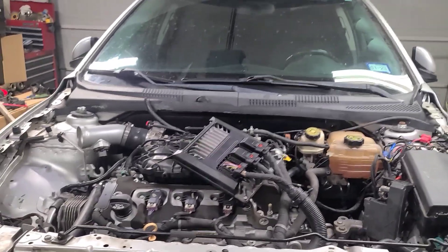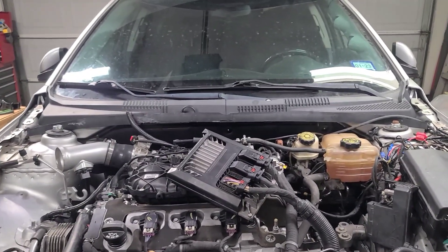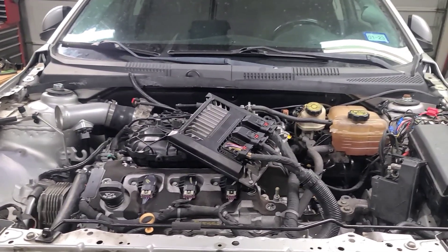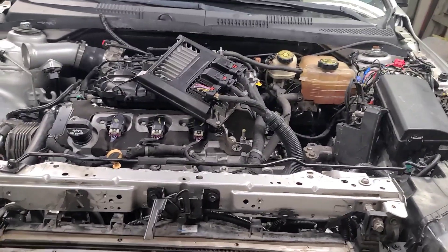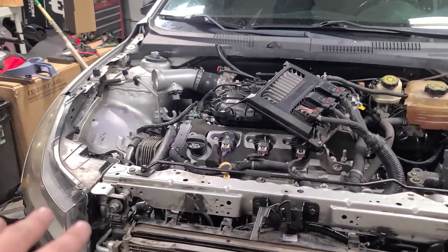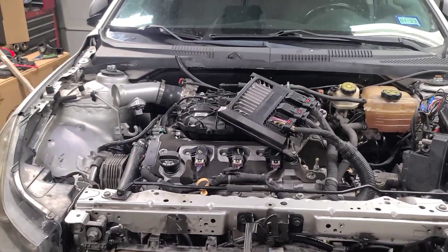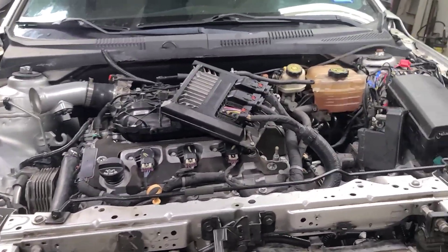Just odds and ends for wiring. The fuel pressure sensor was supposed to share a common low reference voltage — on the Cruze it connects on the engine harness side, but on the Impala it connects on the body side, so I had to connect those two to get that light to go out. The only thing I'm really waiting on is the air box. Once I have that, I'll have no check engine light whatsoever. I did turn off the E85 sensor for right now, so technically I would have still had that one, but once I get the air box in, we're good.